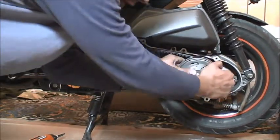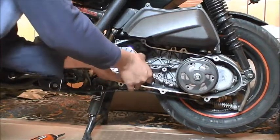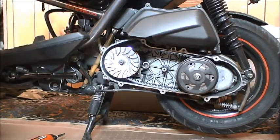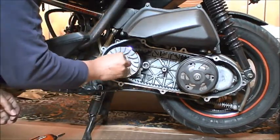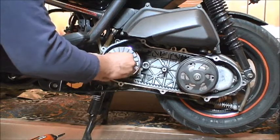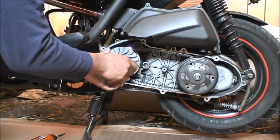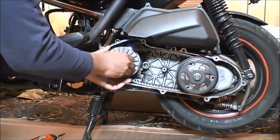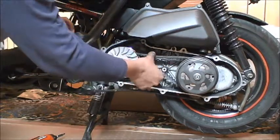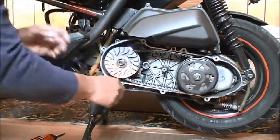I always have a lot of space on the torque driver, so I have ample room to tighten this down. I pinch it up and make sure it's as far back as it goes — you should still see some of the splines on the end. Put the castellated nut on there. You should see that belt moving with plenty of slack behind there. This way you know you're not squeezing on the belt.